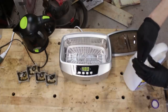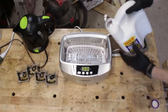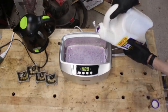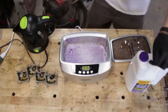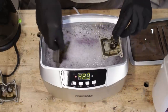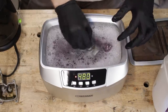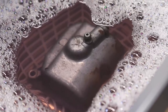One really important thing I want to mention is the cleaning concentrate I'm using — it is Simple Green Pro HD. I spent countless hours researching what to get, because there are a lot of cleaning agents out there that can damage and discolor aluminum. But this stuff is non-corrosive and safe on metals. For my guinea pigs, I decided to use two of the float bowls so we can see a direct comparison with their counterparts. It's as simple as just tossing the parts in, closing it up, and turning it on.